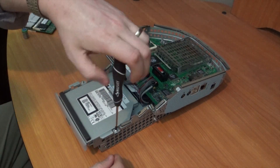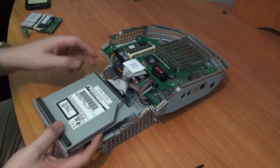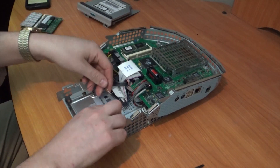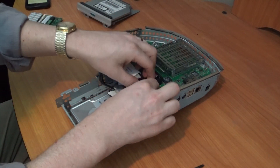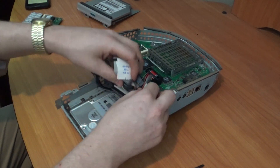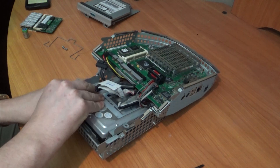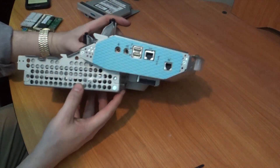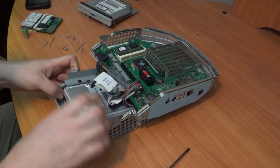If this is your first time getting to the hard drive in an iMac of this era, it may be a little confusing and awkward. Once you take the CD-ROM drive out, you have to push it back and then lift up to access the hard drive caddy. There's a wire holder you need to pull out, then unplug all the wires from the motherboard. You then push the hard drive back and lift it up — there are latched feet on the bottom that hold the caddy in. Look into the side to see the orientation of the clips, and once you push it back far enough the entire caddy will come out.